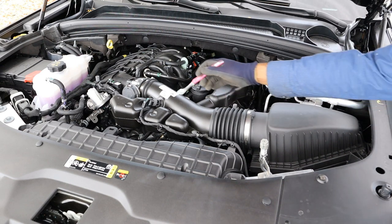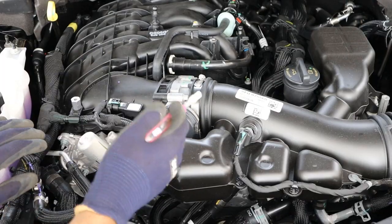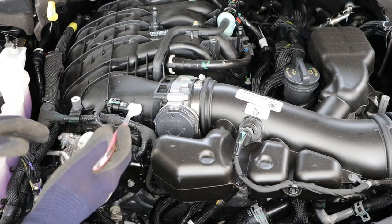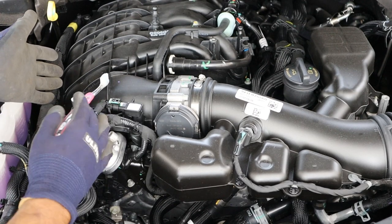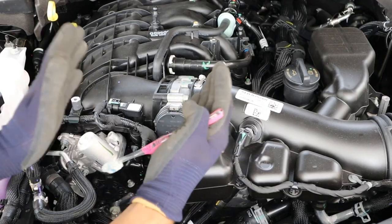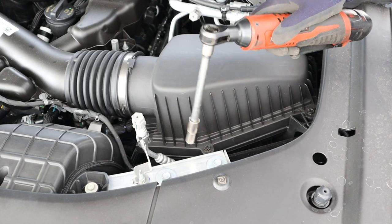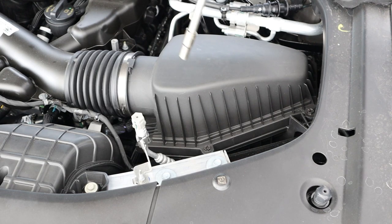That air travels down through this tube over to the throttle body, passing these weird looking air resonators. The air intake is made of plastic and hangs out on the passenger side, drawing air down into the middle of the engine where it splits between the two banks and cylinders to get burned. Changing the air intake on one of these is actually not too difficult — there's a bunch of 10 millimeter bolts that go around this housing here.